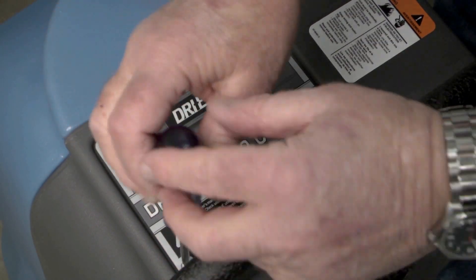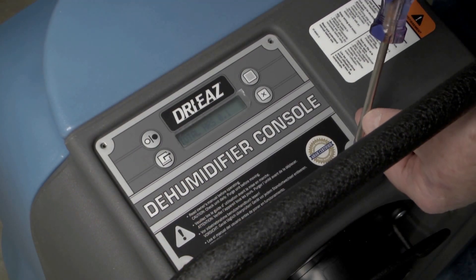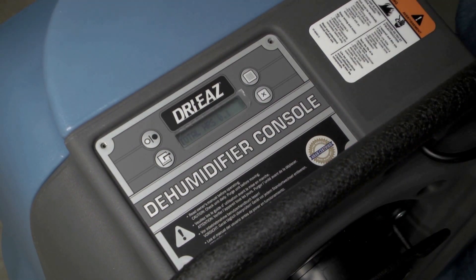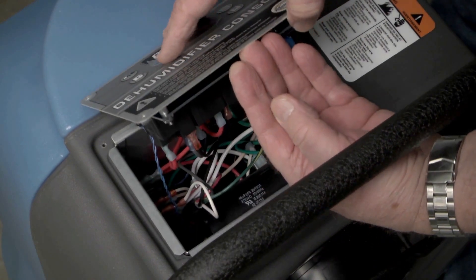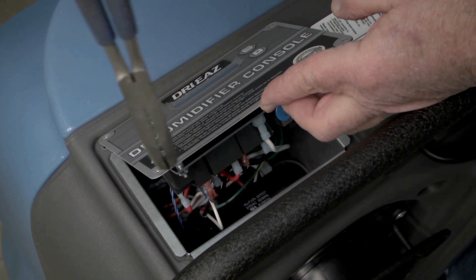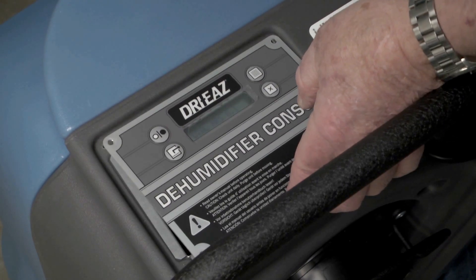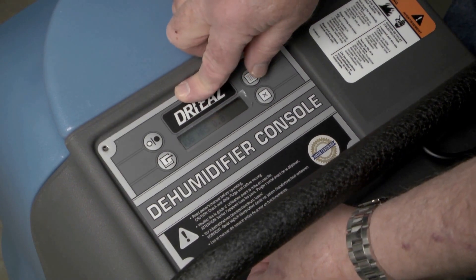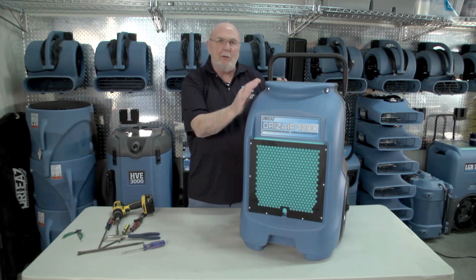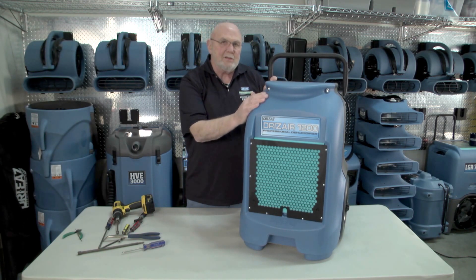This is electronic — you don't have to force it, you just barely have to touch it and it comes on. Sometimes E8 can be cleared up by paying attention: there is a little post that transfers the physical motion down to the actual switch on the back part of the control panel. You can take a pair of needle nose pliers and adjust that post so it doesn't have the switch locked on or prevent something from turning on. These panels are fairly pricey, so it's important to take care of your equipment. Thank you for stopping by — if you take care of this unit, it's really going to serve you well. One of the best tags I've ever seen on a unit was simply: this unit pays your wages. Take care of it.